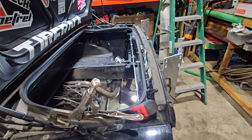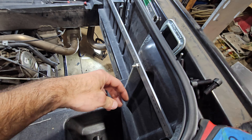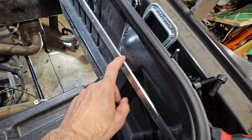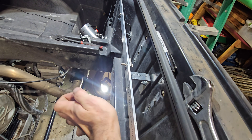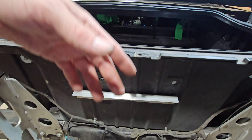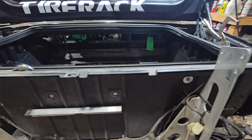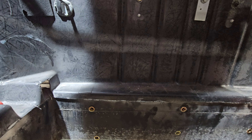Time to get to work. Building this mount - after I got it mocked up, this is what I came up with. I got aluminum bar that comes across and it uses the existing little bolt things in here - there's one here, one there, so it clips in. I drilled through, put another one there, and then made a little offset bracket in the middle to support it. It's actually pretty strong. On the back I used a scrap piece of aluminum and JB welded the bolt in so I can take it off from the other side because normally the skin's there.